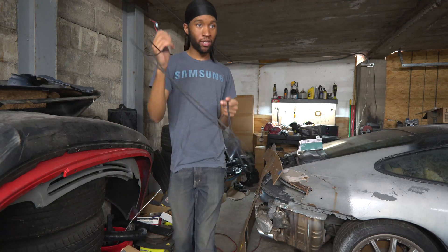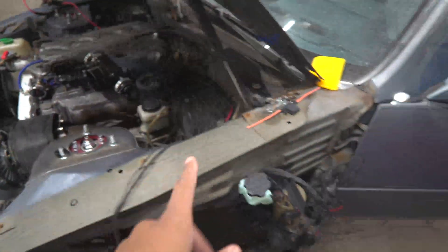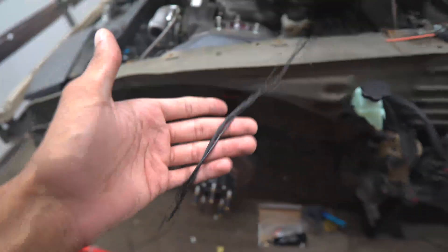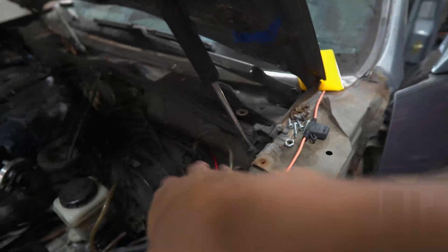All right, let's get this thing wired up — I'm going to put it in the car. The way we're going to get into the cabin is through this grommet just under our master cylinder reservoir, right in this corner. I'm going to poke a little hole, which should be more than enough to put these through, then wrap the end with electrical tape just before I pull it through to keep it watertight. We're going to come in there, go just behind the little fuse box, run up, and go right in.